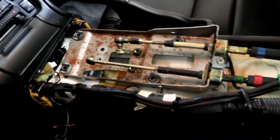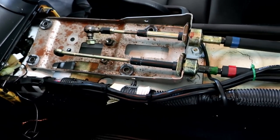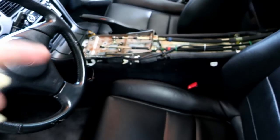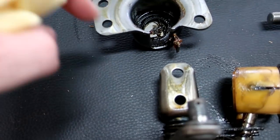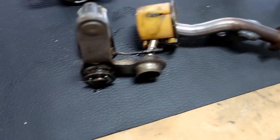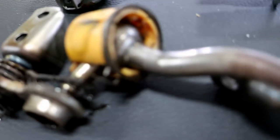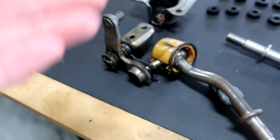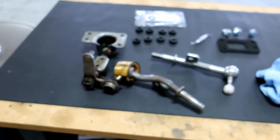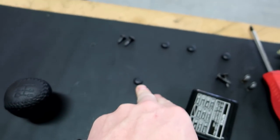We've got the shifter out. Everything is out of the car now; I left the plate in there itself. You can pull out those two tabs where the red and blue cables go through — they were giving me a little bit of a fight, so I just pulled out the whole shifter anyway. I've got the metal cup the shifter sits in with a little rubber piece in the bottom. I'm going to clean out all the old grease and re-lube it. This one actually comes with a new Delrin piece, so all I've got to do is pull that apart and slide this in. Realistically this is about a 30-minute to one-hour job depending on your tools and getting these little caps off — those were by far the biggest pain.